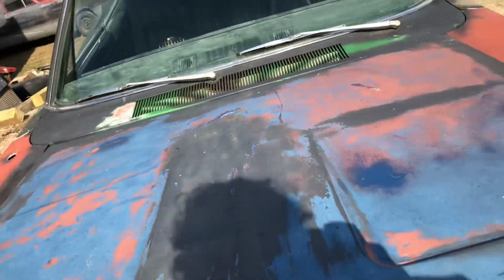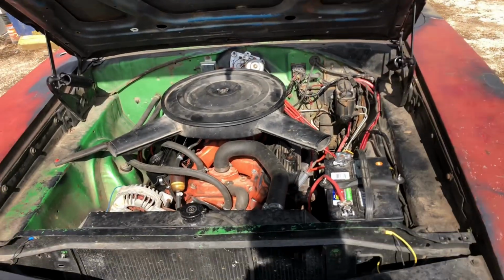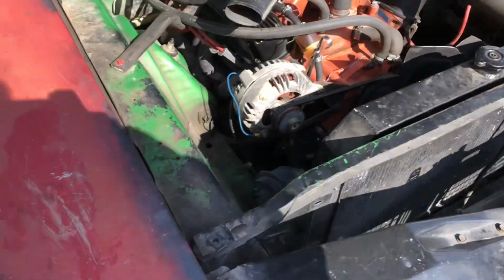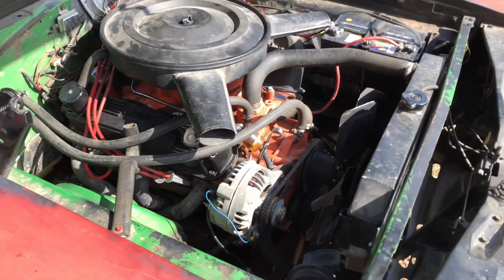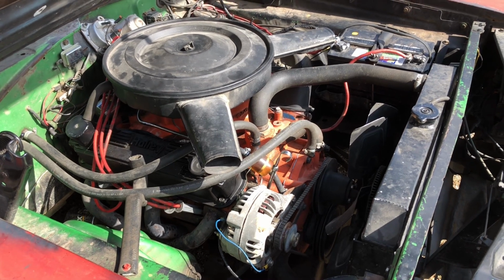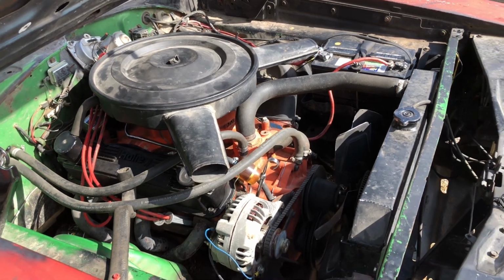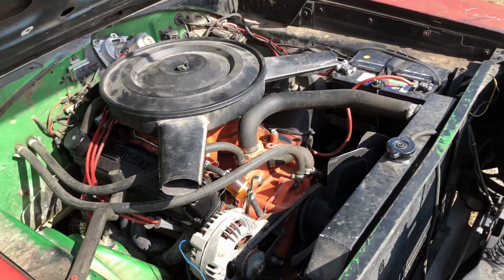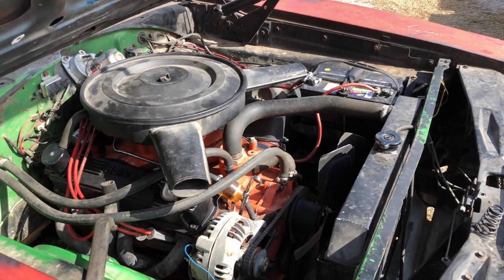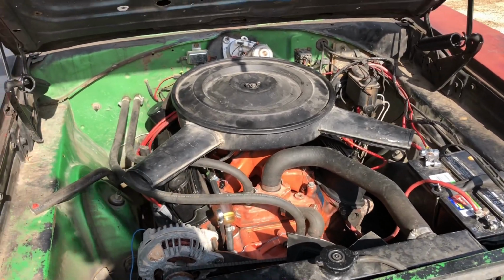Well, I've been having problems. It's always had just a little bit of problem, but it's not been major. The engine's strong. It's a 1970 340. The heads are 360 heads, the early 360s, I think. I think it came out of a 73 360. They're the same size valves as what the X heads on a 340 would be.